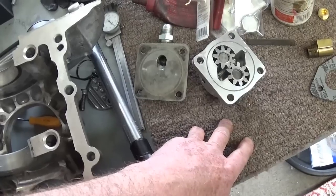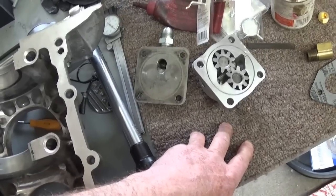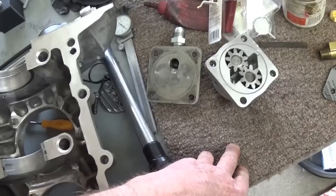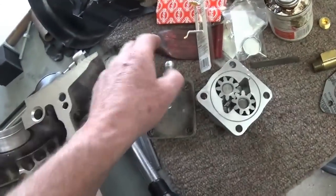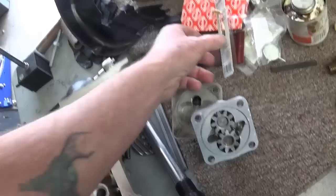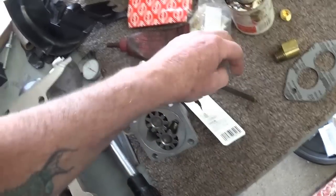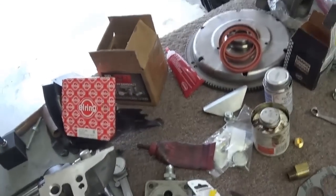It's a good idea before you put your rocker arm assemblies in to crank your engine over with the spark plugs out and let the oil pump pressure come up and get all the galleries filled. I've done it both ways — it's just, if you want to be thorough about it, it's something you can do. Since this isn't a mass production project, you can take your time. A lot of people won't and don't and wouldn't even think of it.